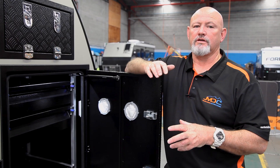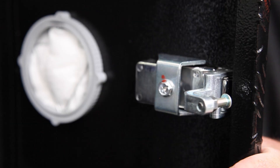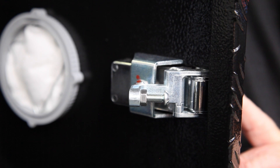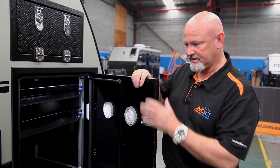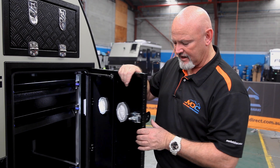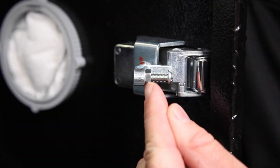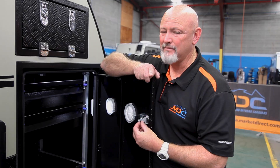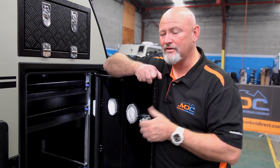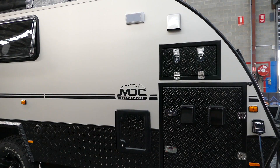On all your locks in the caravan, when it pulls into the seal on the inside it has to be a medium lock — nothing too tight. You want it up to about 80%. If you push them too hard — past 90% — you are going to break them. If you need to readjust, there's a 10mm nut: undo it a quarter to half a turn and it pulls the catch inside just a little bit to create a slightly bigger seal.